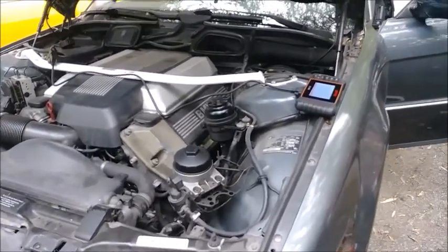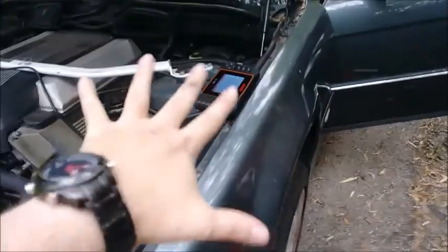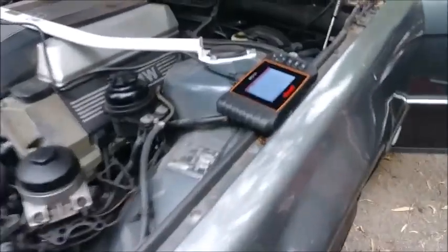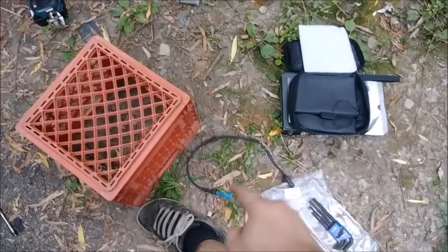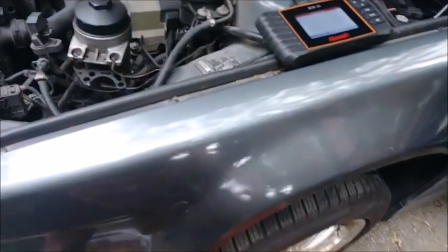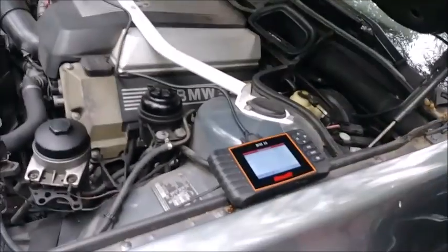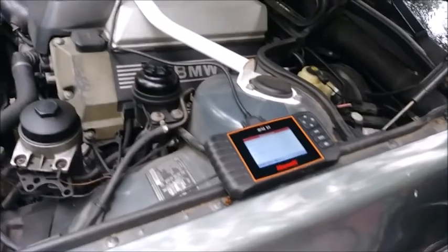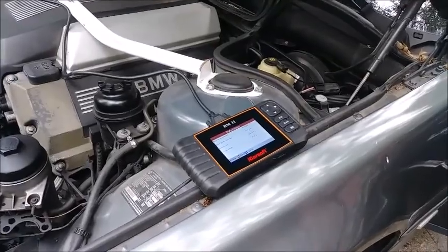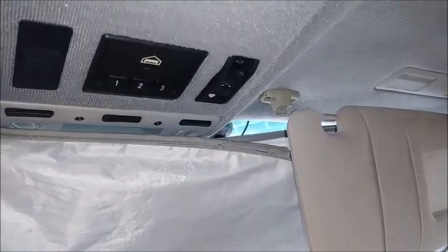That's all she wrote — that is how you properly diagnose and replace what's wrong with your ABS, dynamic stability control, and brake warning when you have the trifecta going on. Not everyone has a scanner that can do live streaming data, but if you have a multimeter like my UEI meter, I showed you how to check the resistance — the old one was 0.608 ohms and the new one was significantly higher. I gave you two ways to do this. Ideally you'd have both tools so you can clear your codes when done. Keep these beasts on the road as long as you can.